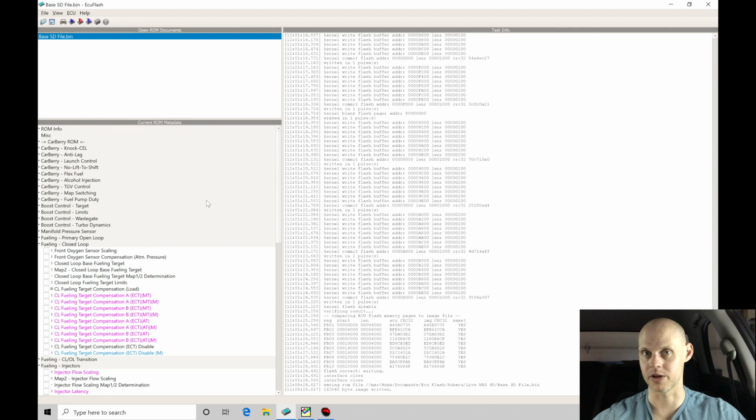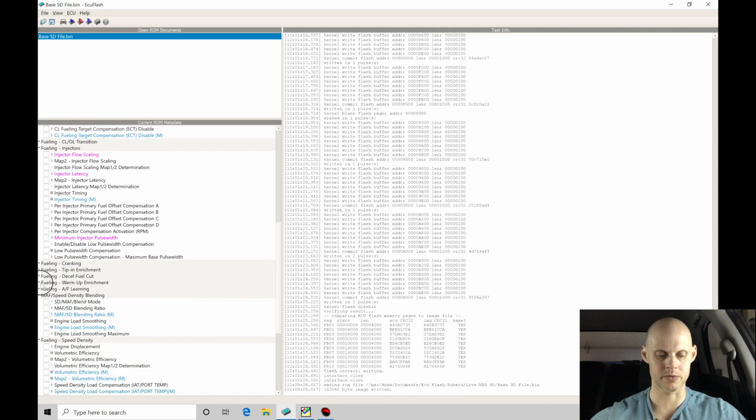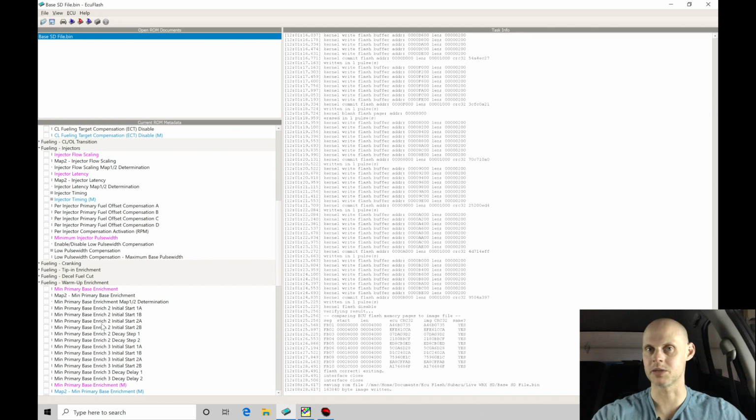and we want to make sure that when we're going in and trying to calibrate and tune our vehicle, that it's up to operating temperature. So all of those adders, the warm-up enrichment and post-start, so our additive 1, 2, and 3 tables, under our warm-up enrichment section here, so that these are dissipated, and we're focused on just calibrating the main table. So what I'm going to do is fire it up, and then we're going to do some data logging, and we're going to allow it to come up to operating temperature.